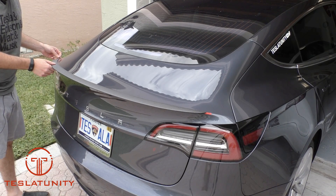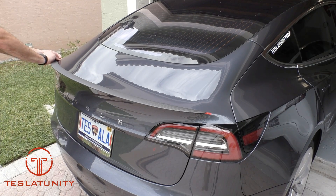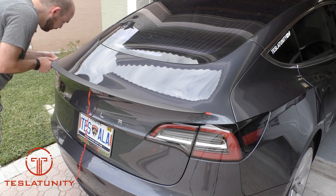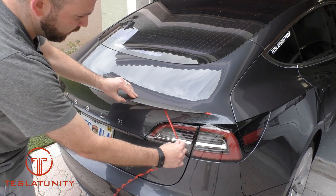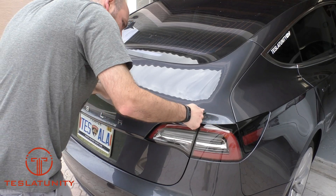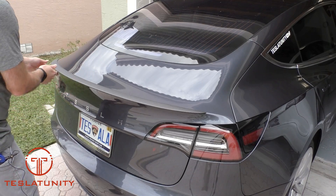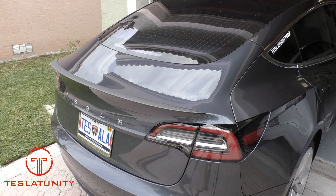So now they say — see if you can see this — there's a little red pull tab, same on this side. We're going to lift up the spoiler a little bit and start pulling this pull tab, get it about halfway, and then seat down that left corner. We're going to keep pulling this out — you don't want to lose this tape in there, that would be really bad. Then we're going to push in the spoiler everywhere. There you go — what do you think?